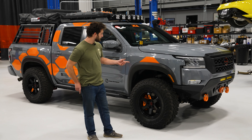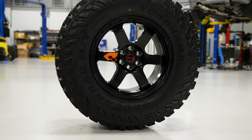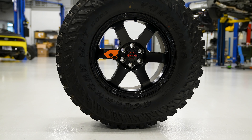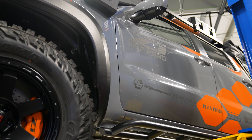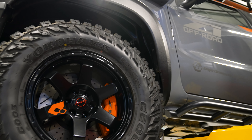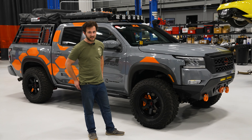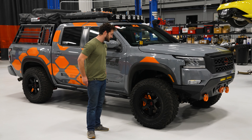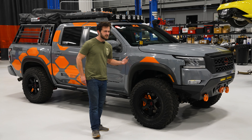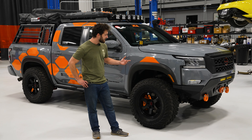I'm going to tell you a little bit about our wheel, tire, and suspension setup for this truck. We're running our prototype ATK06 Z1 Off-Road wheels that we developed here in-house — this is a 17-inch wheel — and we've got a 295/70 Geolander mud terrain on here. These tires are awesome. We've had the pleasure of taking them out on the trail and we haven't gotten this thing stuck. It comes out to be about 33.5 inches, which was a little bit of a challenge to clear.